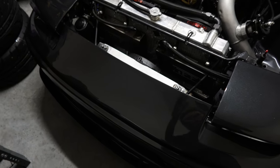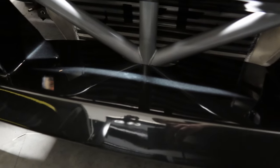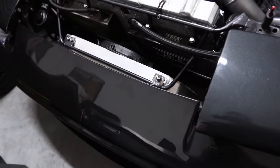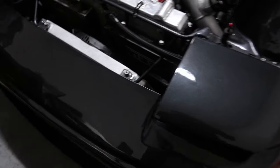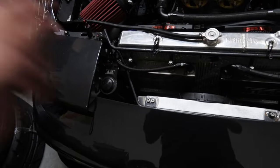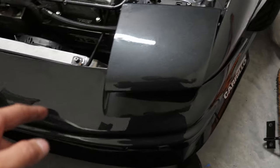The bumper has to be fitted tomorrow. Now, I did fit this bumper for the previous setup, and I got to trim out the front for the intercooler and the new bash bar, but it all looked pretty sweet, all up in there, brand new bumper, brand new fresh painted, stick it up, all ready to go. Intercooler fan's on there, wired up, and once we get back here tomorrow, we will trim the bumper, get it fastened on the car, and we should be good to go.